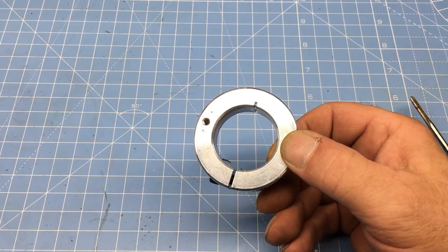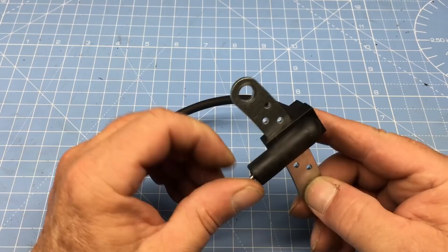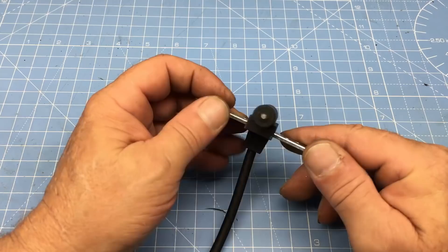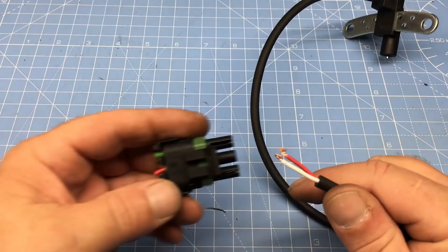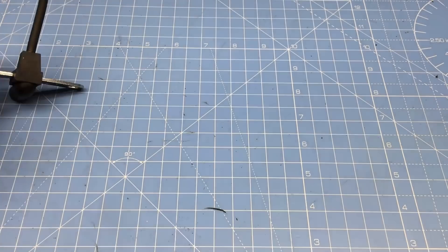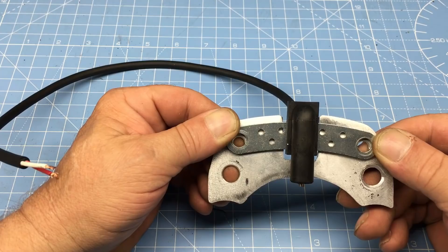Well, that was a quick and easy job. The shaft collar was drilled and tapped for 8-32 fasteners — that works out to be close to 4mm in case you're wondering. The crank position sensor looks like it was made for a lawnmower engine, but it's not a Ford part — my best guess is it's from a 6-cylinder Jeep engine. It had a pretty decent weatherpack connector, but I clipped it off because we're using Deutsch-type connectors on this build. We have some good mounting points on the engine block. Unfortunately, this crank position sensor doesn't quite fit those mounting points, but we'll make it fit — because that's what we do. Off camera, I fabricated a bracket to mate the Jeep part to the lawnmower engine, and overall it's a very tidy package.